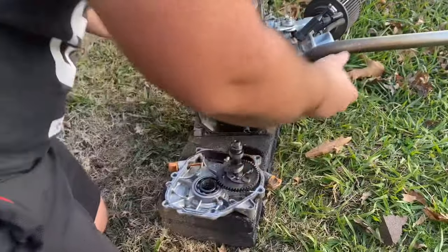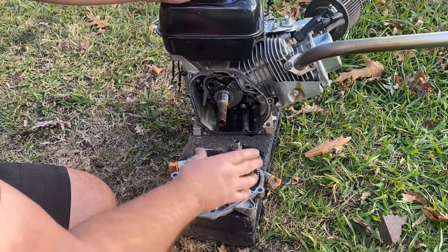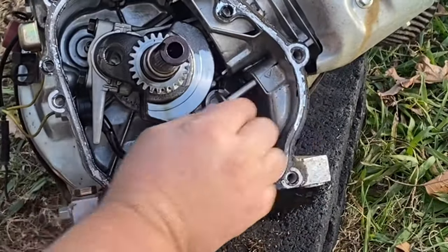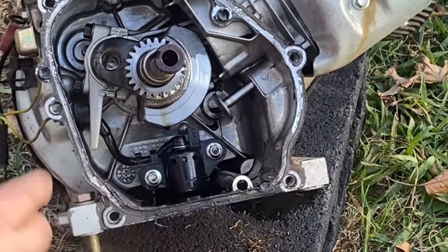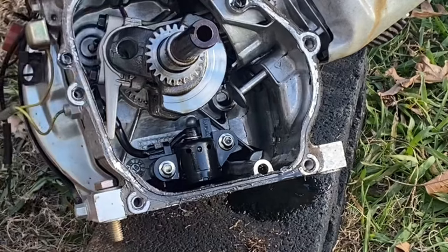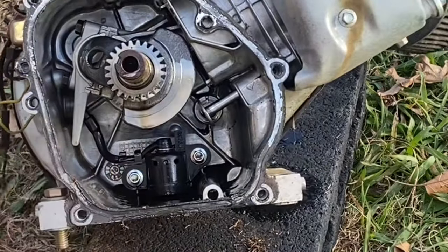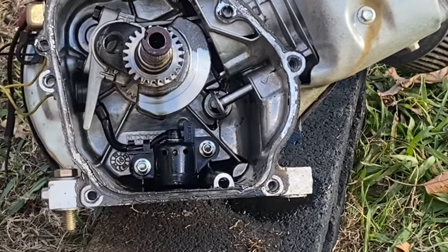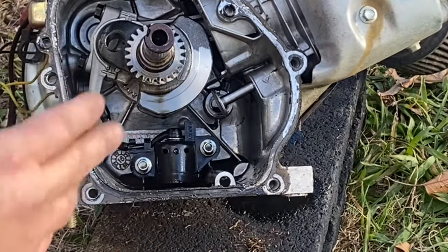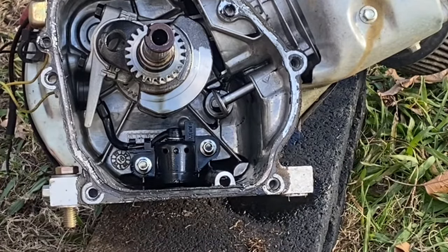Most of the time when you take out the governor, your cam comes out when you take the side cover off. One of the most common things to happen is once you take that cam out, the tappets that hold your push rods fall down and take pressure off of the push rods. So the push rod falls out of its seat up in the head. When we take the valve cover off, more than likely those push rods are not going to be in their seats anymore. This is probably the most common reason your Predator won't start after you remove the governor, because if you had that cam out, the push rods fall out of their seats and you're not going to have any valve control after that.